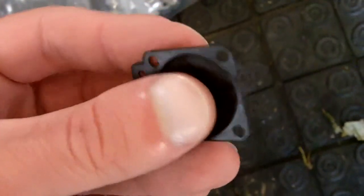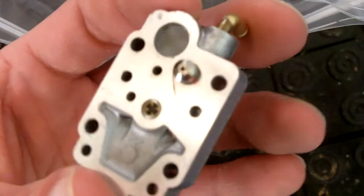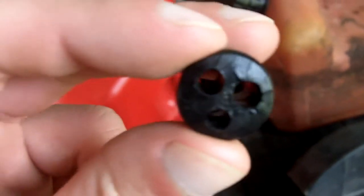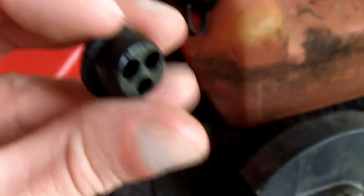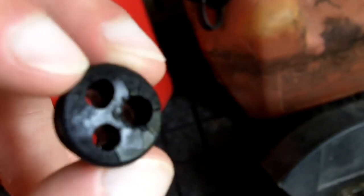The metering diaphragm on the carburetor is real stiff and real wrinkled, so I'm going to have to get a diaphragm kit for the carburetor. The carburetor itself is all clean — I made sure of that. Here's the grommet that goes onto the gas tank — apparently it's all cracked and brittled, so that's going to need to be replaced too. On the inside it looks okay, but the outside just looks real bad.